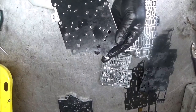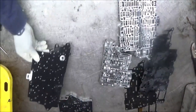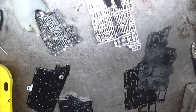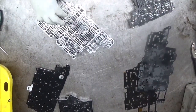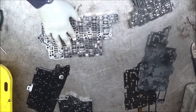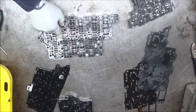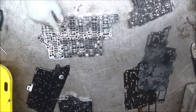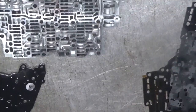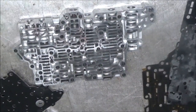If you have a hole that blocks something, you will be taking it back out. Now this is going to go over here. We have these valve bodies here, and this has the check ball in it. We're about to put these check balls — there are nine check balls in there. I showed you that you should mark where the check balls go. I put marks on here, let's see if I can remember where they go.